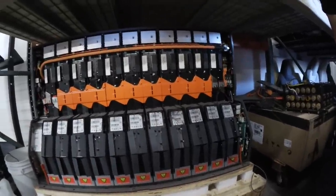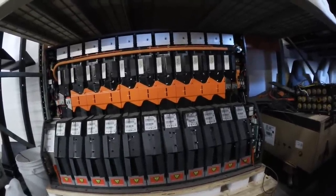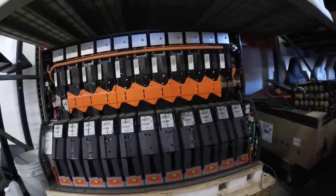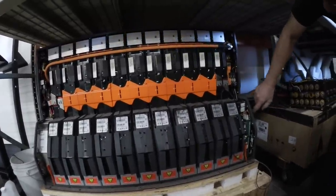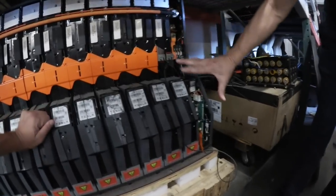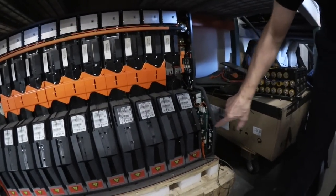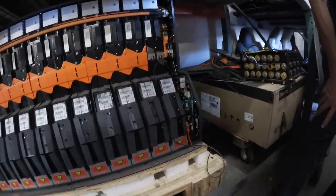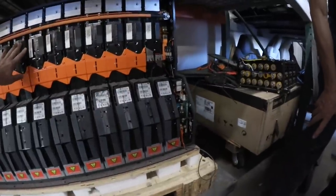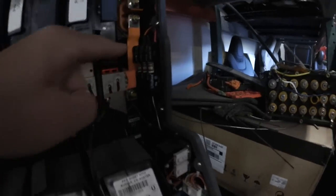We need to solve that mystery of how to open the sheets to take the batteries out. What I've heard is they are all manually manufactured — people sticking batteries into those sheets, not automated. Also, if you notice here there are fuses inside this pack. This pack is completely sealed and sits inside the bowels of the car. From a design standpoint, you have to question why you'd put a part that could need replacement in such an inaccessible place. To access a fuse you have to drain the cooling liquid, then you can get to the fuse — and you also have to drop the battery pack, crack it open. That's a DC fuse.